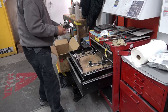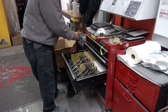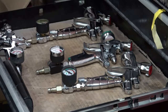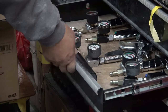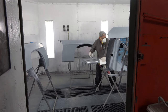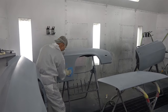In this scene the painter is getting together all of his paint gun attachments. Nowadays the paint systems use a plastic jar or container that has a special top on it where the paint guns press onto, so you can use different colors with different jars and just press in the trigger gun. You can see him separating them by color. Here he's wiping down with thinner and blowing off the dust, then wiping them down with the tack rag.